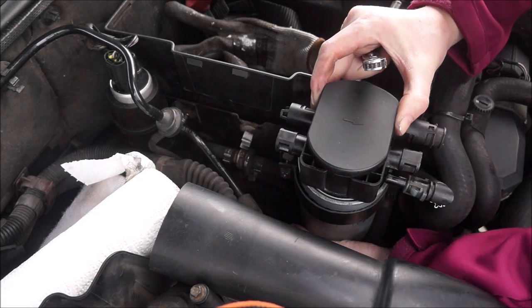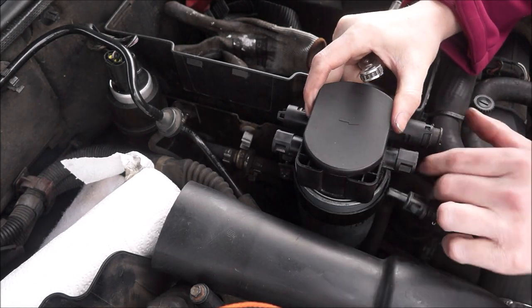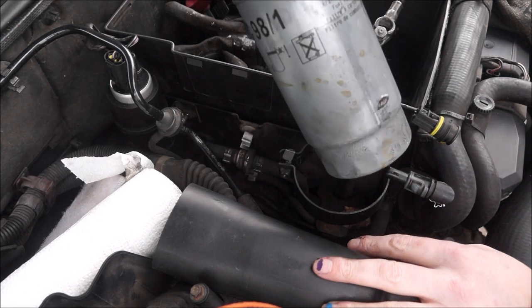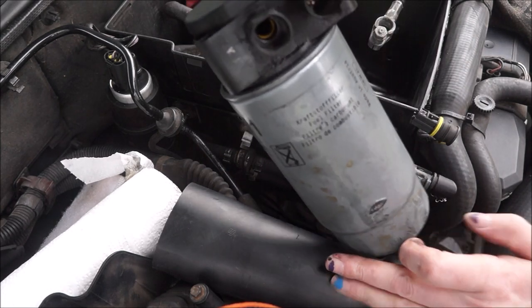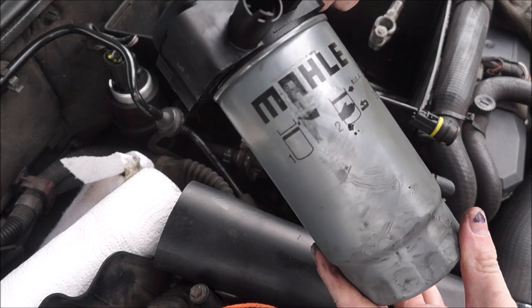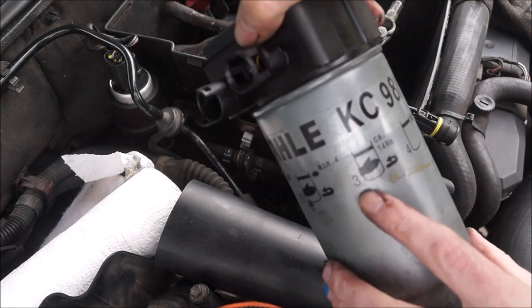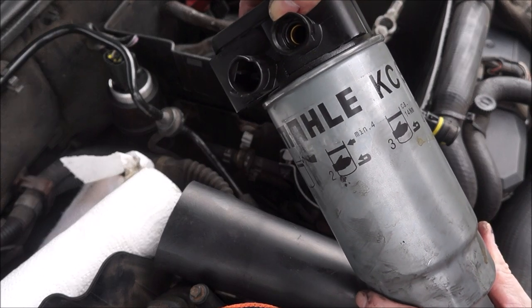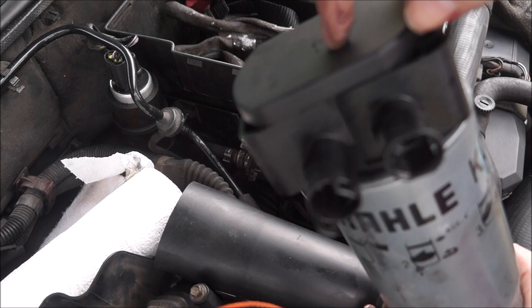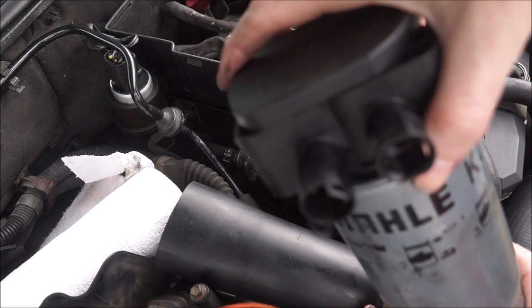Is that loose? Anything on the bottom of that? No, it's just a can. I need to get this connector out — there we go, get a good pull. Let's lift this out — yeah, that looks pretty grimy around here, it's pretty filthy and it's got wear marks on it. So you've got one, two, three, four — fourteen newton meters I'm guessing. I'm guessing you just turn it hand tight like you would with an oil filter, so that's exactly what I'm going to do.